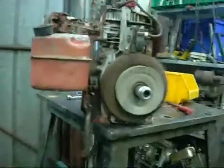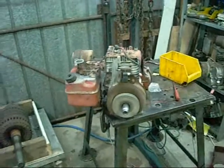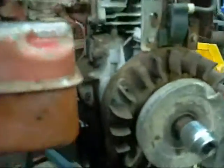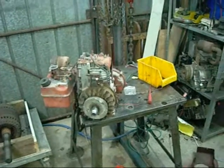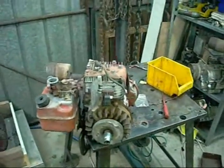It's pretty hot - I've got a broken fin. A bit of crud burning off the head, yeah it's just warm. Well it works - obviously raising compression raises the idle speed, but this thing just wants to break free of the table and keep going. So it goes to show you can shave about 2.5 to 3mm off one of these heads and it still works, bringing the compression right up even with a busted ring and a big deep score in the bore of the cylinder.